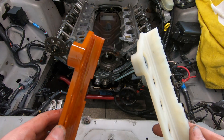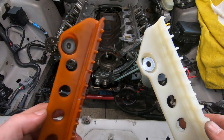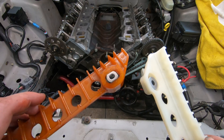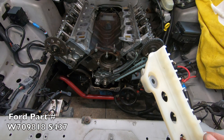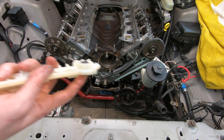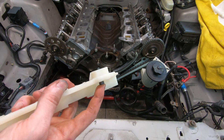Just a quick note here: the passenger side tensioner has been revised at some point between 2001 and 2019 by Ford — it requires a longer bolt, so you have to source another bolt. I'll put the part number in the description. It cost me about four bucks for this bolt, but you can only get them in packs of four from the local dealer. I ordered it online for about four bucks and got one bolt. As you can tell with the old bolt, there's no way it's going to work — you're going to have to source a new one.